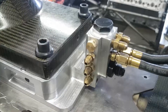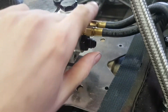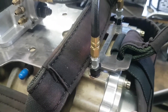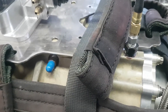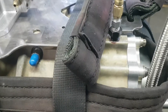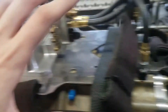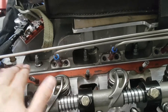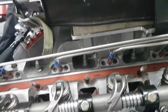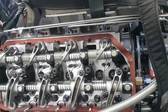Now, as I was saying, we've got our line up here going to the rear distribution block. We've got three lines coming out here to this side, and there's three lines that come out here to that side, and there's four here that go to the rear of the blower. See, we've got one here, one here. These cool the blower down because there's no other way to cool the blower down at the back half — fuel doesn't actually quite get back there, and it prevents it literally from melting. That's a common problem. So these lines up here don't have any of those check valves. For us, these lines here have check valves and these lines here have check valves. Now, again, this all varies depending on what sort of tune-up you're running, but for us, it's what we go with.